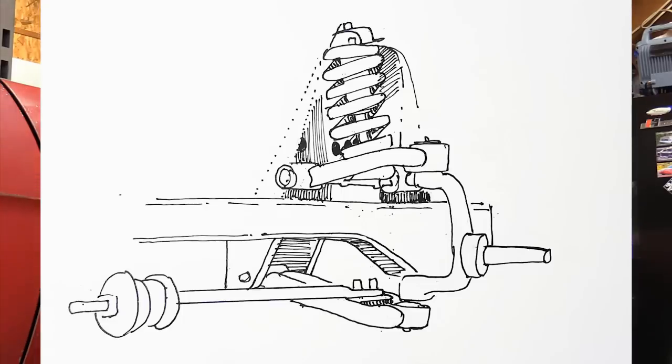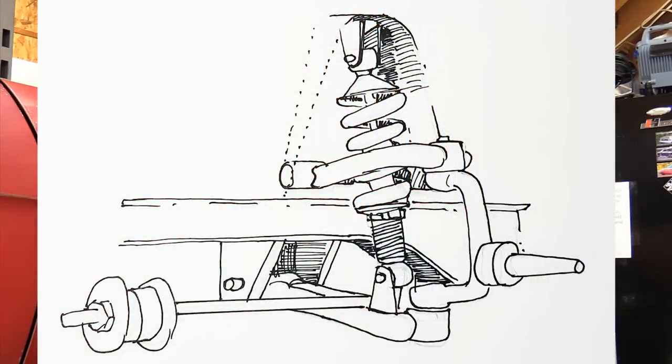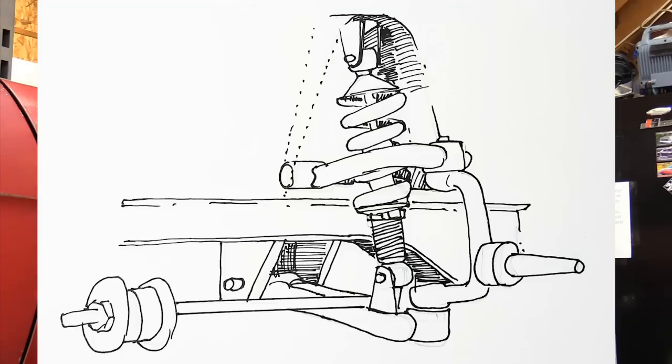The stock style still has the coil up on top of the upper A-arm, and there are systems where you can do a coilover on top of the A-arm to make it even more modified. Both of these systems are non-invasive — you're not going to have any changes to the chassis that would prevent someone from going back and doing a complete bone stock restoration on the car.